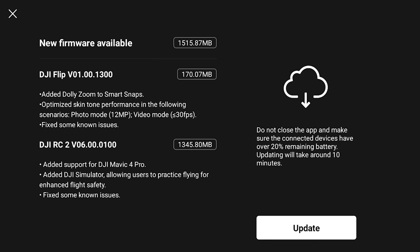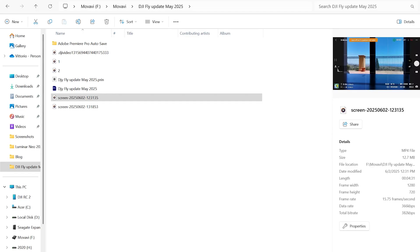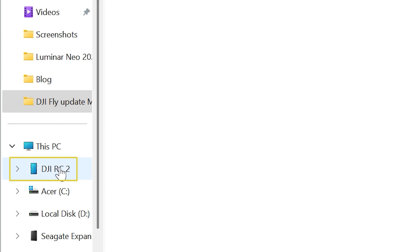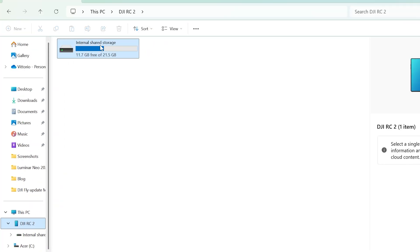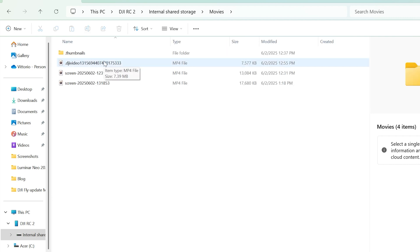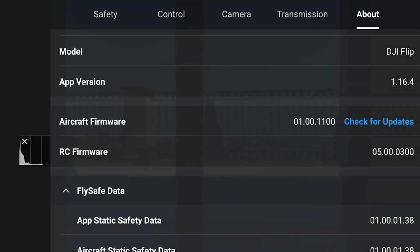The two files are quite bulky, and after clicking on 'Update' I found a message informing me that storage is insufficient. I've seen numerous messages on forums from users struggling to clear storage space. The easiest way is to connect the remote controller to a computer and turn it on — a folder with the name of the controller will be available. Double-clicking on it, the files of the internal shared storage are shown. Open the folder 'Movies' and delete the files inside it; if needed, do the same with the folder 'Pictures'.